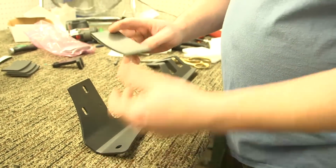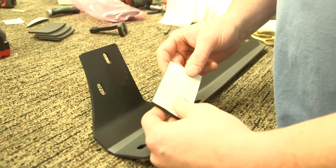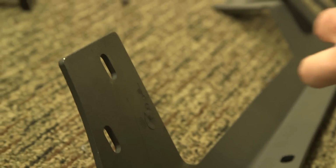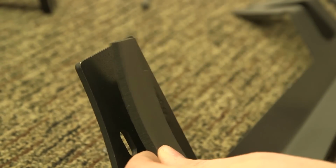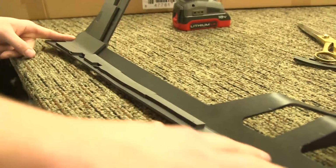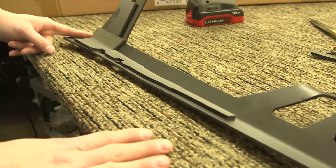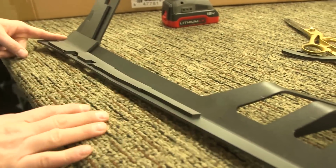It's important that you use something like a closed cell because it'll keep the water from soaking into it like a sponge, and it'll repel water more than it'll let in. Capillary action will soak the water into the middle and hold it up against that paint. You don't want that, so this will keep that from happening. We limited the foam to this distance because this actually comes away from the rest of the painted surface up here and spreads out a little bit.